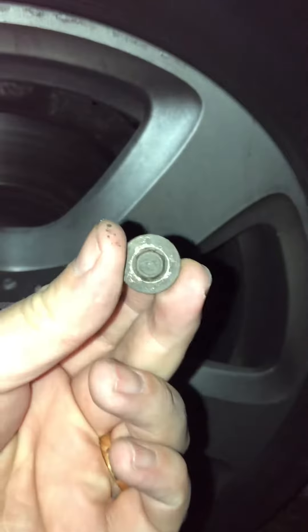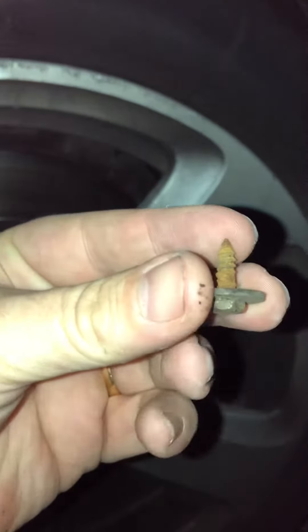The problem, my friends, turned out to be behind this panel on the front right wheel. You have a series of bolts — there's around 6 or 7 of them, 8mm sockets — throughout the panel here, the top panel and the lower panel. It could have been an easier way of doing this, but this is the way I did it anyway.